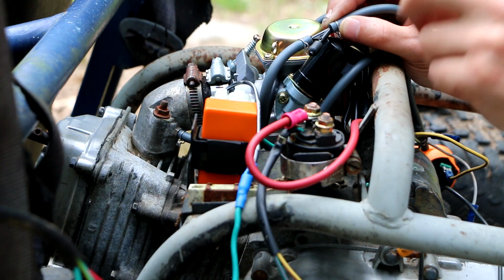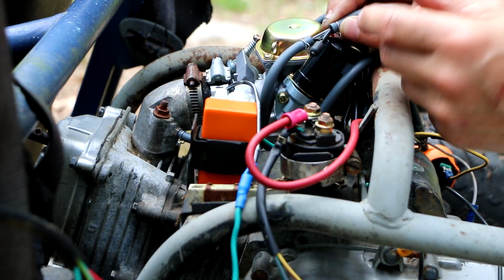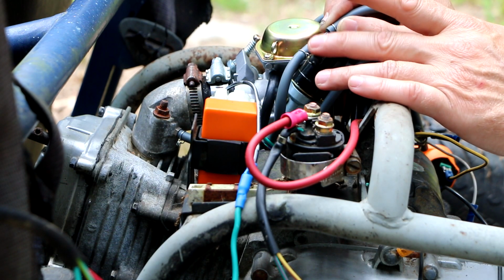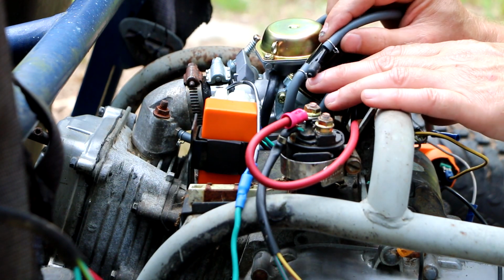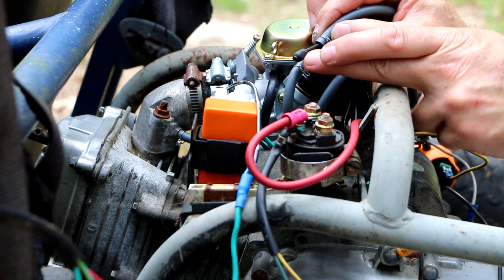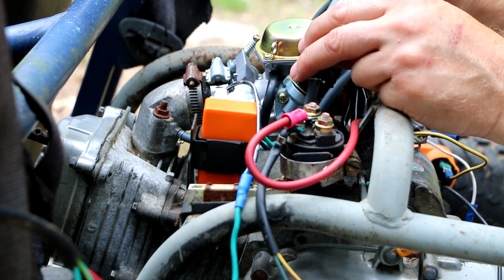It's got a multi-position knob that you can either shut it off, has reserve, it has on, like with the vacuum, and then it has like full on, which bypasses that vacuum circuit. Because if something goes wrong with that circuit, if you have a vacuum leak or whatever, you're not going to get fuel. So in this application, because we don't have that type of a valve on the tank, we just want this capped off. But you have to have this blocked if you're not using it, because if we take this cap off, obviously you're going to have a massive vacuum leak,